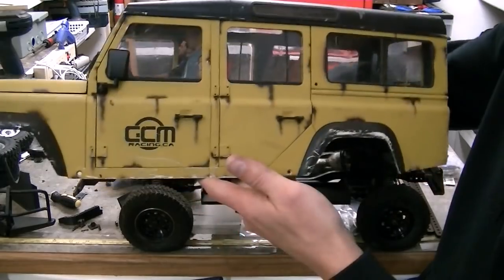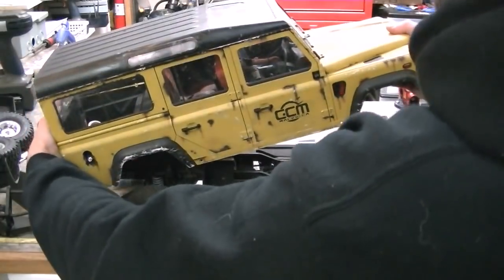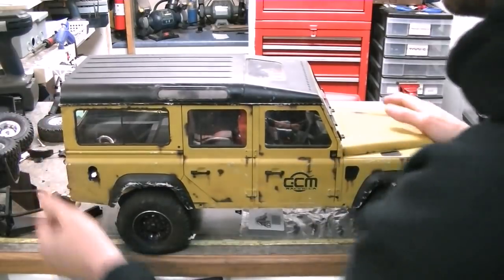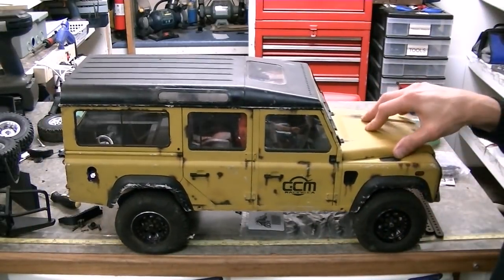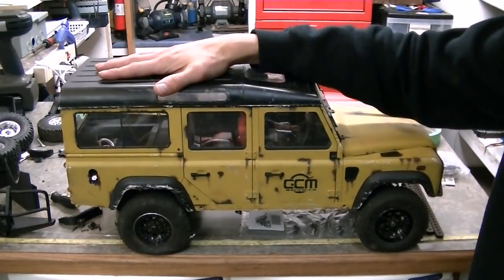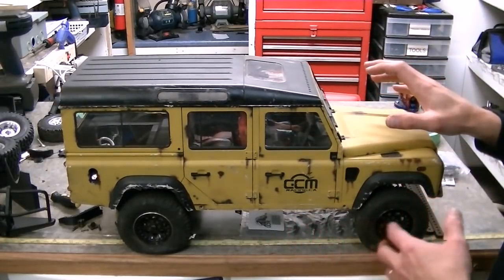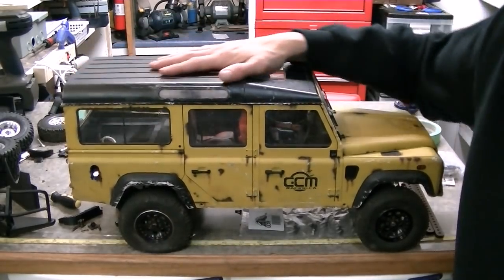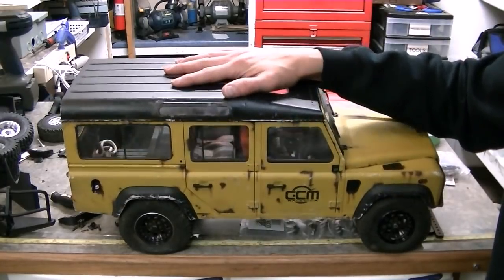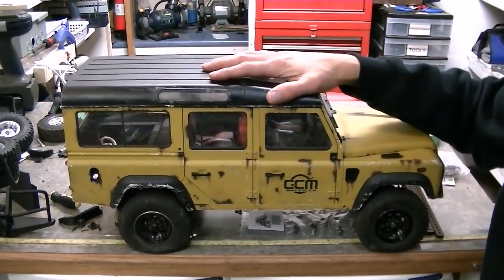The cool news is it drives fantastic. For any of you guys who have actually seen this truck out on the trail, it's a beast — a thing to behold. It rides really good. The suspension feels way too stiff when the body is off the truck, and I knew that when I was playing with the spring rates. But I've come to realize that when the body weighs 2 kilograms, you need a heavy spring. It does not take much to get this thing to flex at all — just the body is so heavy. It rides so good.